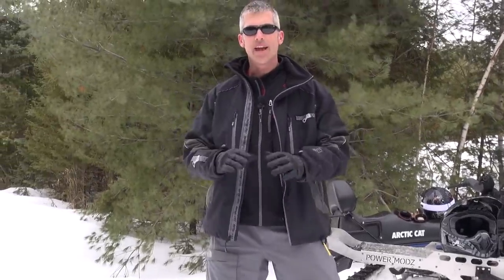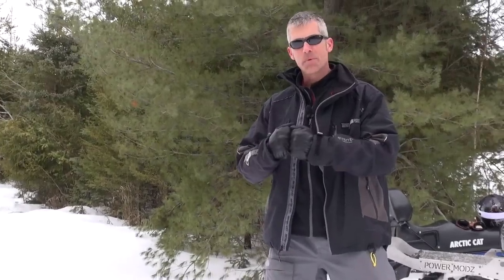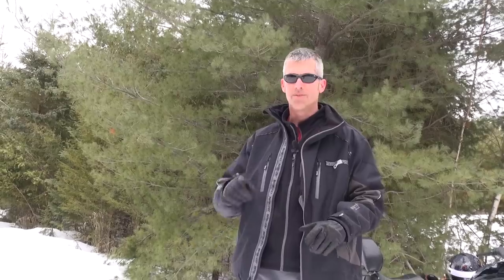So as you can see, I used very little power, very little pressure to actually pull him out. I took up the slack on the line before I pulled him out. You don't back up bumper to bumper and then full throttle it out. You're going to run into problems. You've seen videos, I'm sure, where things have let go. You don't need to do that. This device works just perfectly if you use it the way you're supposed to.